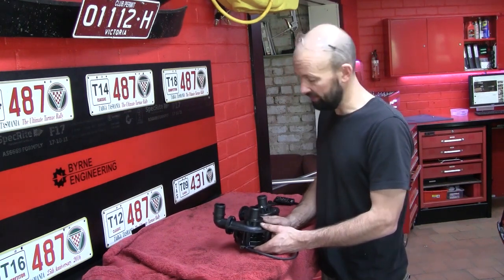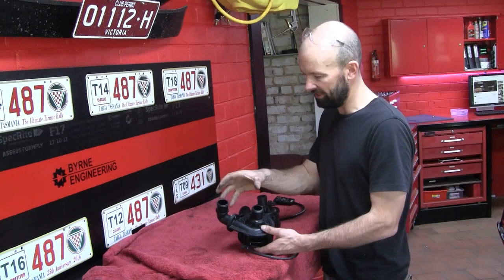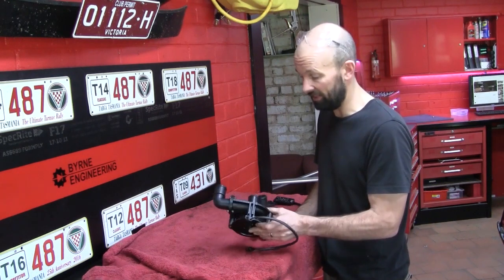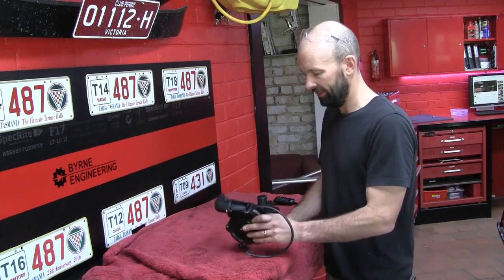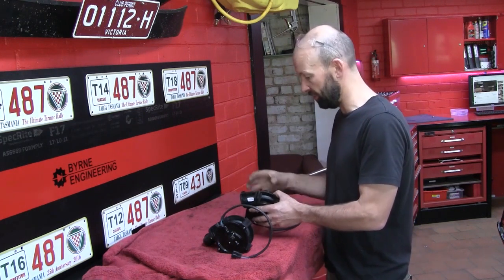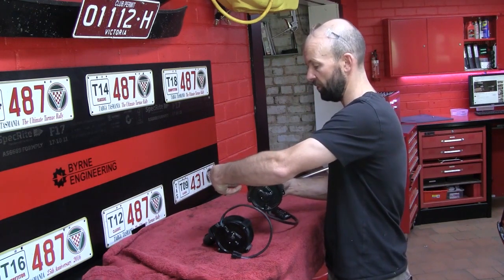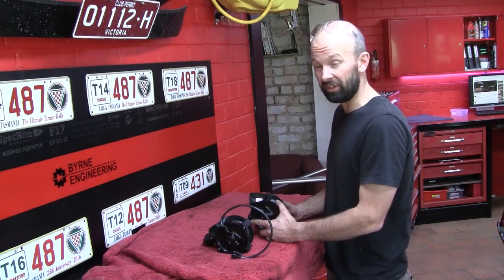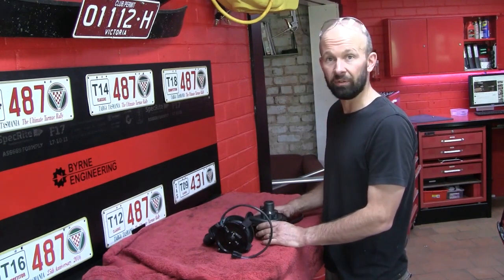They're usually pretty easy to fit, but this car's going to be a little bit tricky. They're designed to be mounted between the radiator and the engine. These will still be mounted between the radiator and the engine, however, the radiator is normally next to the engine, not at the other end of the car. Apparently, it's not a good idea to rigidly mount them off the chassis. Issues with thermal expansion and contraction. So they're designed to just hang in the radiator hoses themselves to provide the actual mounting. So a bit of trickery, I think, is going to occur to get them suitably positioned in this vehicle.